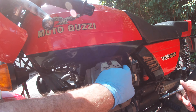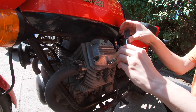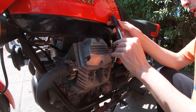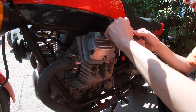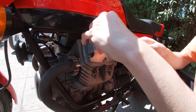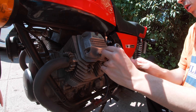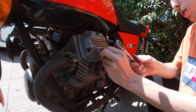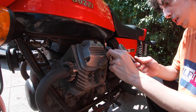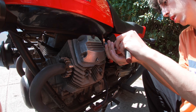Next you've got one, two, three, four, five, six bolts all the way around that go onto the rocker cover, so you just need to undo them. These are soft aluminum ones — a big recommendation I've always found is you don't go to the recommended torque settings, you go slightly less. It's better to have it slightly loose and even leak a little bit — I'd prefer that to the thing shearing off, because then you've got to take the head off and have it machined. I always sweat when it goes tight, thinking 'oh please no' — because the shear is an absolute nightmare.